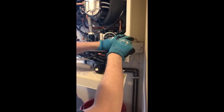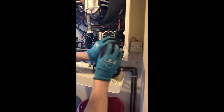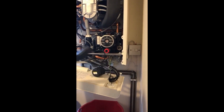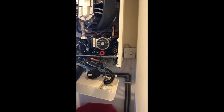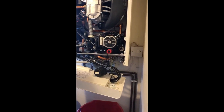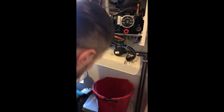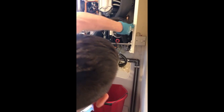Get away any obstacles and take out the motor if you need to. I've taken off this side panel as well for easier access. Have your wet vacuum handy if you have one, because you're going to get a few drips and you don't want to get them in the electrics. If you do get water in the electrics, don't turn the power on — get a hairdryer and dry them out. Now I can start pulling out the plate heat exchanger. Turn it so it's facing upwards so you're not going to spill any more water, and put it somewhere safe.